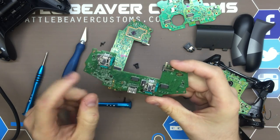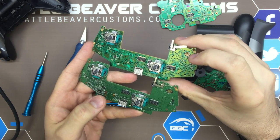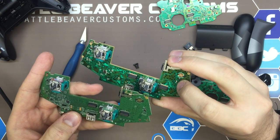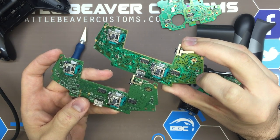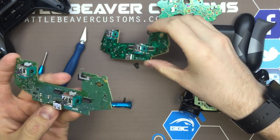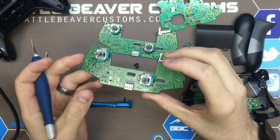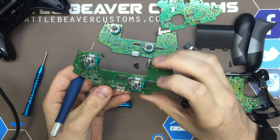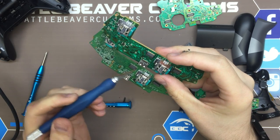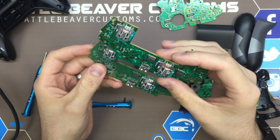On the main board, we see a lot of resistors and capacitors moved to one section. They still kept diode 14, which is open and not used, and added a test point for B where before we just used the top half of diode 14. Overall it looks like a lot of aesthetic changes — we saw this with the 360s, which went through five different board revisions. I don't think they changed the grounding. They did add physical resistors at the front for their proprietary connector, being used on every lead — another interesting observation.